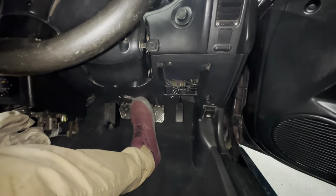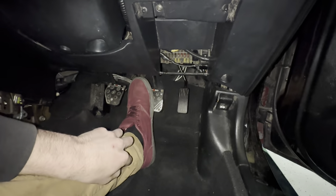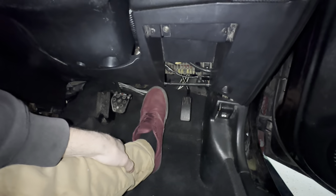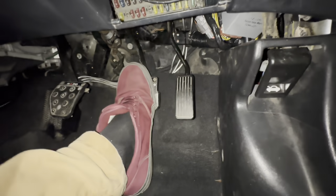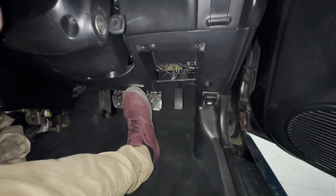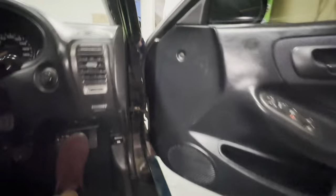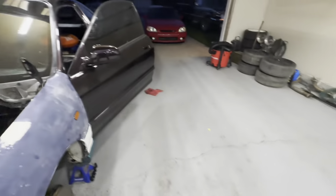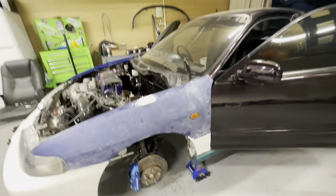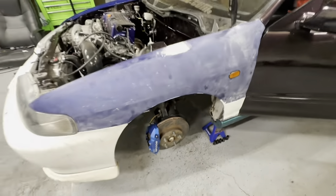We got a little bit of pressure out of it. With a Wilwood brake booster delete, you're supposed to have a really hard pedal — as if you're in a car that isn't running with no vacuum assist. We got some pedal pressure, but it's probably only about 60% — not ideal, not safe driving conditions. So we will not be running it like that. It's just going to take a little bit more time. This concludes the Spoon caliper installation video. I hope you guys learned a thing or two — thank you.